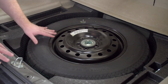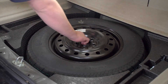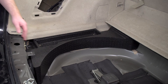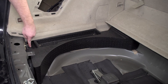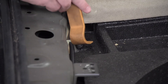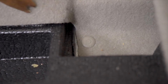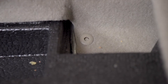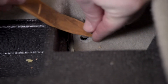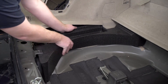Next we'll need to remove the spare tire. Then we're going to remove this foam tray on the driver's side. It's held in by a pin right here, and there's a push pin back here. We'll start with this rear pin and use a trim panel removal tool. For the forward push pin, first we'll have to push the center in, and then we can remove it. Now we can pull up on these side panels and remove our tray.